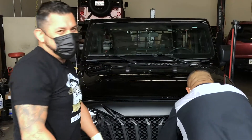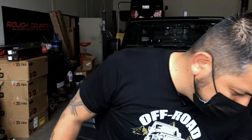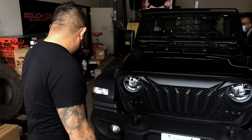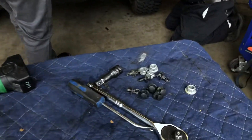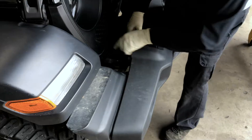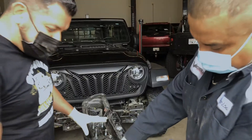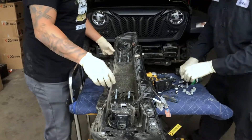That's the expert right there — he just went in there and already knew where everything was. That's when you come to the experts: Vicious Off-Road. So the four screws are out. Now we're going to get underneath Willie and there are two more at the bottom. We have to take this bracket off because this is where he's going to take out the wiring for the fog lights. Now we can take out the fog lights.